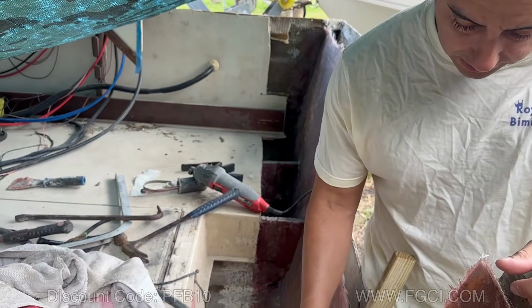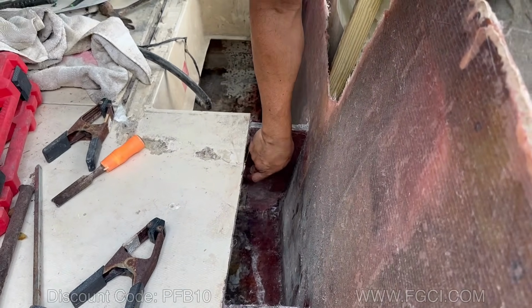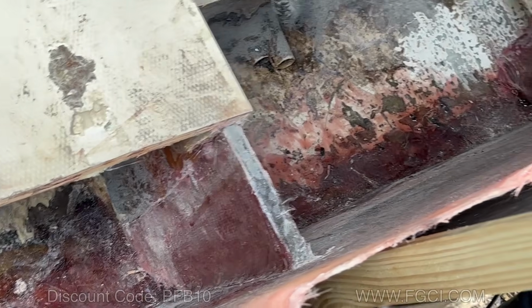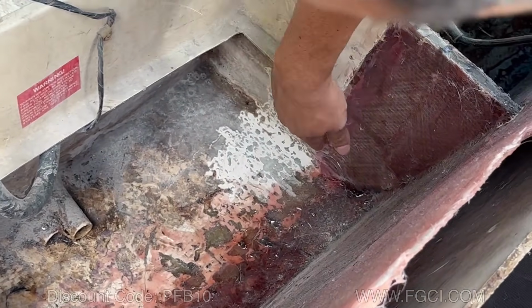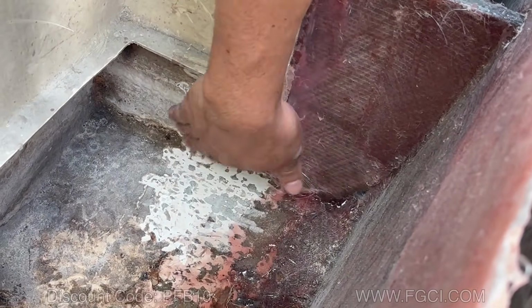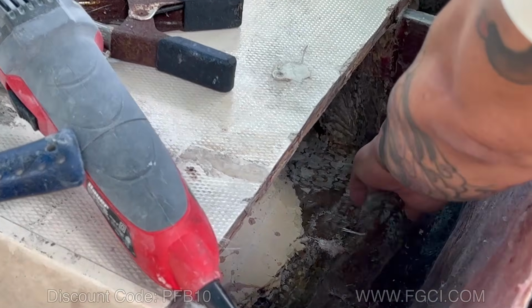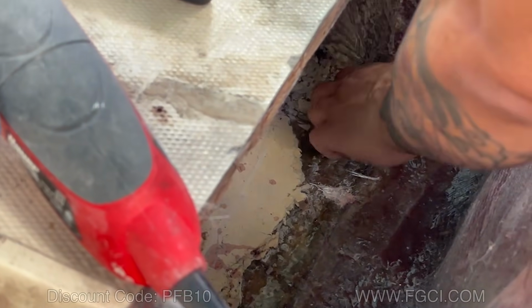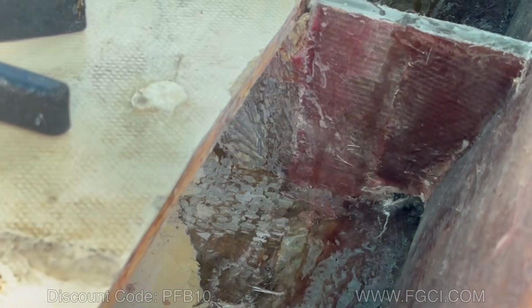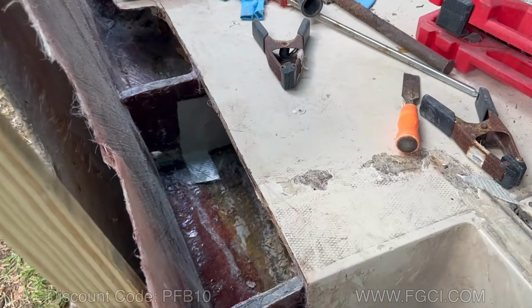All right, now the final step before we put the board up here is we've got to laminate. We've got to connect these 2 stringers together here. And for these stringers, I'm just worried about laminating up here. You want to try to get as much gel coat as you can. This is woven, so it's very hard to get into it. You're going to have to take off a lot of material. But like over here, scratched up over here so we can laminate one piece like this, 2 pieces over itself, and same thing on this side. That's what I want.